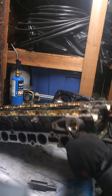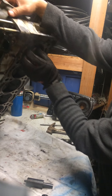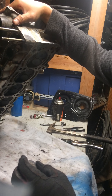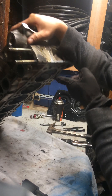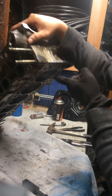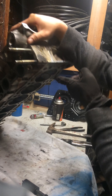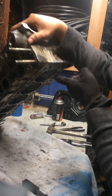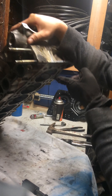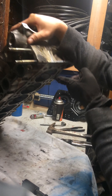And then I've got my valve seal — it looks to be bad. This motor was bad, had a hole in the block, but get the head looked at and see what they say. After that, if I want, I can lift up on the head, pull the valve out, and put that valve in a piece of cardboard like I showed in the earlier video.